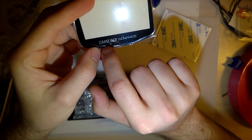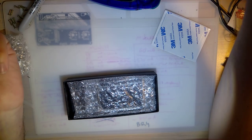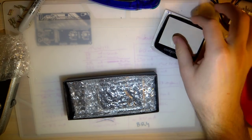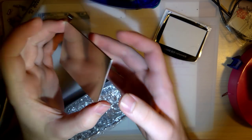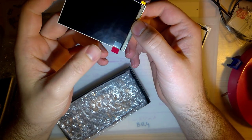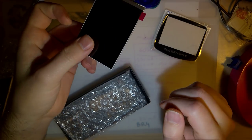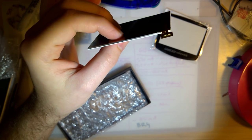The nice thing about this lens is not only is it glass, but it doesn't have that rainbow logo you see on most aftermarket ones - personally I like that a lot better. Next you've got your screen itself. There are zero markings on this - I'm not sure what it's out of. Initially I thought it was an iPhone screen like an iPhone 3GS, but it looks a little too small and it's the wrong aspect ratio. There are just straight up no markings on it. This thing is ridiculously thin, which is both good and bad - good because it gives you a ton of room in the Game Boy Advance, bad because it makes the screen more delicate.